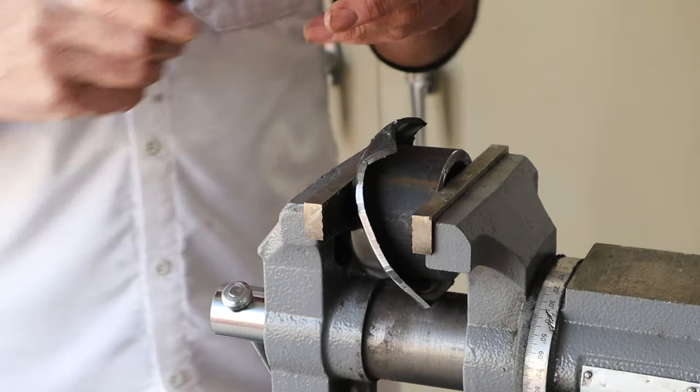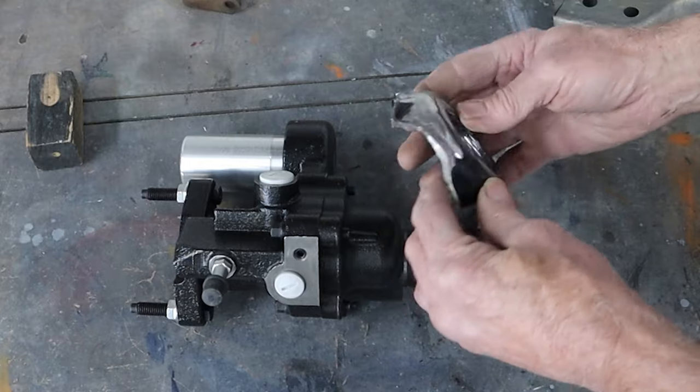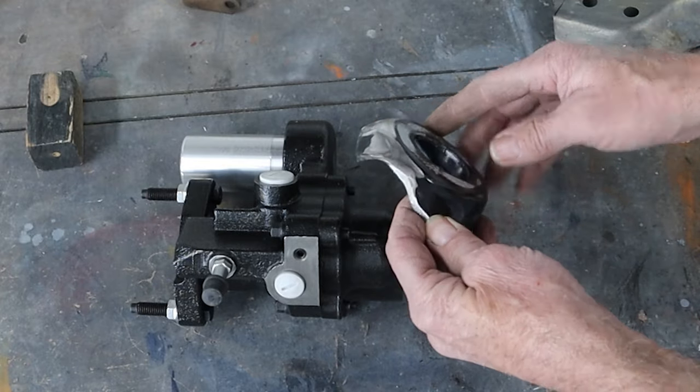This stuff is pretty thick and the hammer ain't that big, so let's whack on it a little bit. If it's going to move, great. If not, I can always slice this pipe open, make a little piece, weld it on here, and cut everything to the angle we need. We'll put a couple of slits in here a little bit of the way down to eat up some of this material. We got that pushed over and gained about a half inch — so that's good.